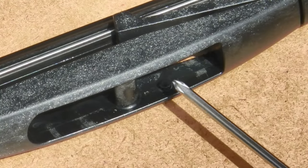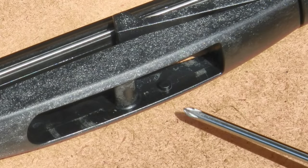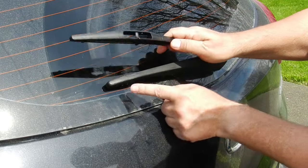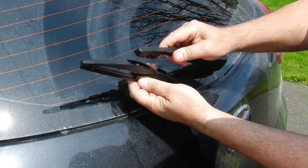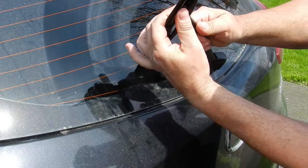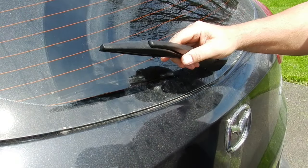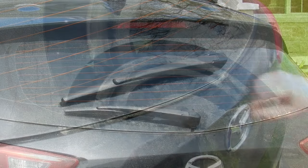This close-up shows a small pin next to the pivot rod in the wiper frame. This is the seat that the pivot rod snaps into, and this is a channel that the small pin rides in. I'm matching up the rounded end of the wiper arm with the rounded opening in the frame. The frame connects to the arm with a solid snap, and that's all there is for the rear wiper fix.